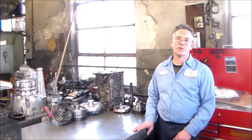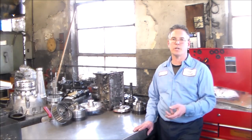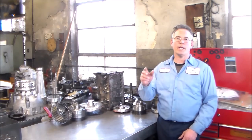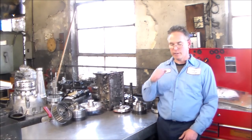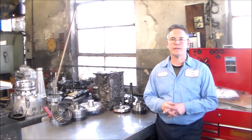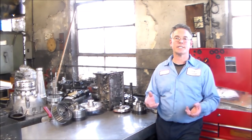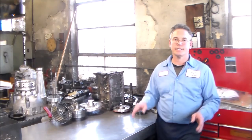There are no codes on the engine, no codes on the trans. What this thing was doing was basically you start out in drive, it would fall out of gear and bang back in. We were able to get it inside, but reverse was delayed a little bit — it had a reverse, but basically no drive. When you switched it over to manual mode and put it down into manual one, the thing took off fine, no problem. Pretty much any time you have that with an automatic transmission, that tells me there's something wrong with the low sprag, because now you have an assist coming on — probably the reduction band — coming on to assist. That's why the car would move, but in regular drive it takes off on the sprag, and probably the underdrive clutch — it did not move.